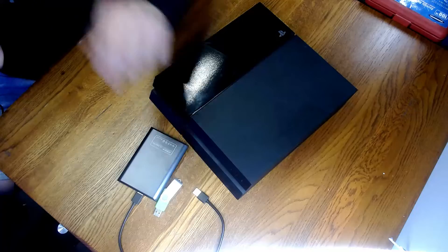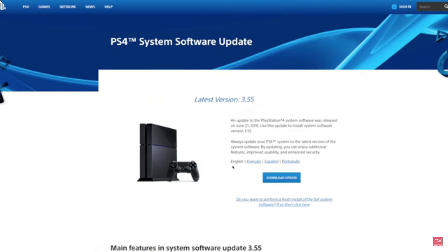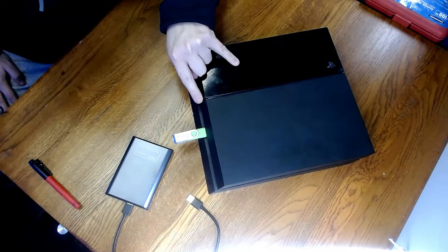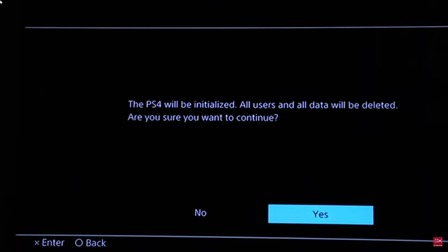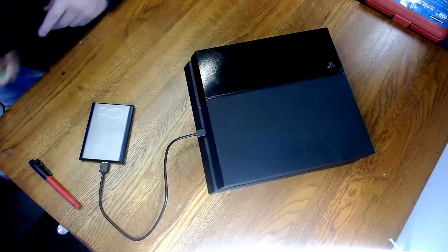All you need to do now is jump over to your PC with your thumb drive. Use the link in the description below to get the most up-to-date software available for the PlayStation 4 — simply download it and save it to the thumb drive. Head back to the PlayStation with your thumb drive plugged in, then hold the power button for seven seconds until it brings up the Safe Mode screen. With your PlayStation controller plugged in via USB, simply follow the on-screen instructions for this step — it is that easy.